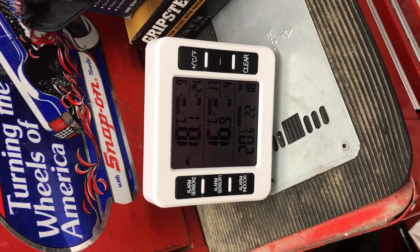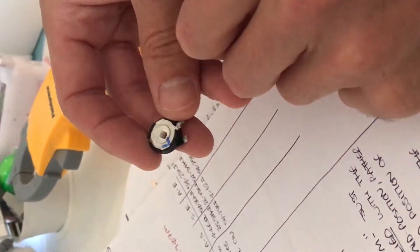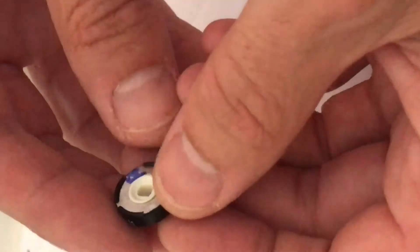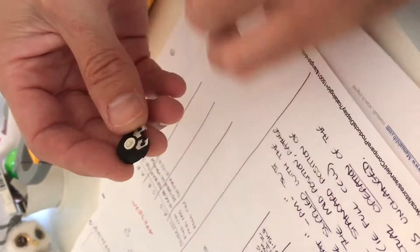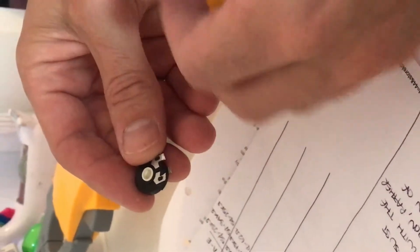Okay, it's the 16th of July. Since yesterday I soldered on the new potentiometer onto the fridge control on the Hotpoint FF200LG — this is the one I took off and videoed yesterday, which had readings all over the place. Now I've taken off this one, which is the right-hand side one for the freezer control. What I'm going to do is test this on the bench and see what sort of readings we get. I might have to use the probes because I've snipped off a fair bit in order to desolder the legs out of the circuit board — clear the holes with a solder sucker and then solder it back on again.